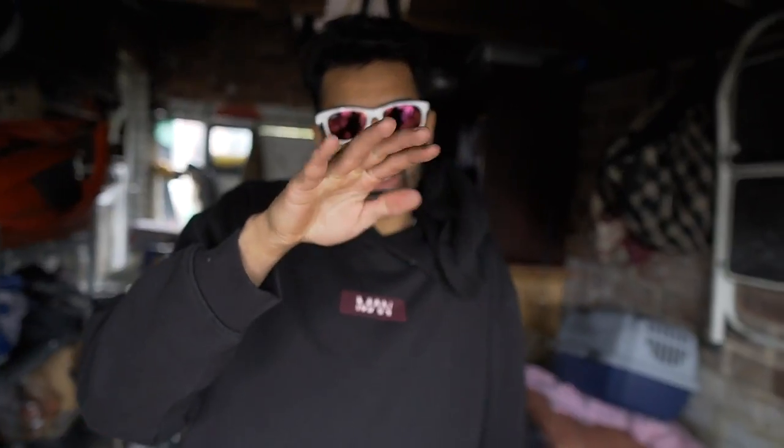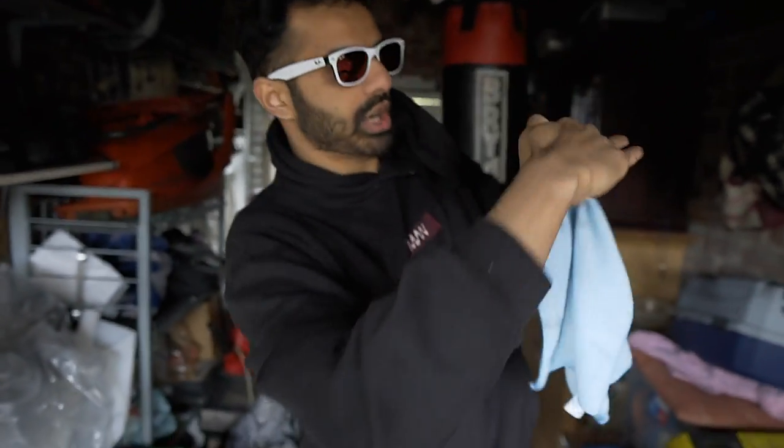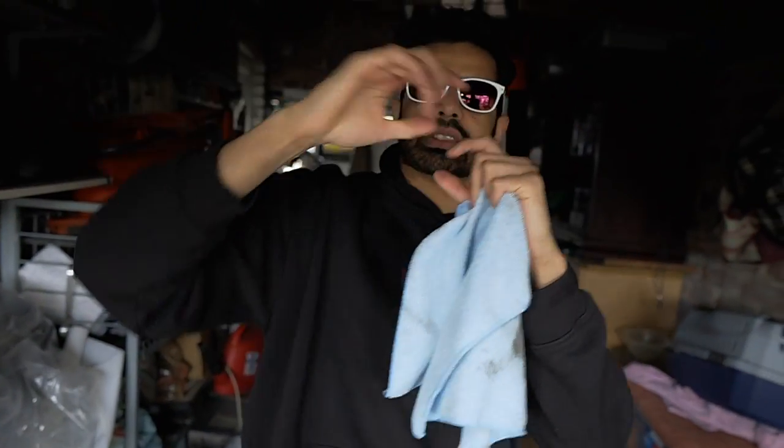Another thing, don't just listen to people on the internet who say just pour 3.7 litres in. If you overfill it, you're in trouble. Depending on how you jack the car up. Because I've jacked it up from the front and the drain plug is there, pretty much all of my oil is coming out because the car isn't flat. But if it's on the ramp, then some of that oil is still going to be there. So it's better if you jack it up like that.